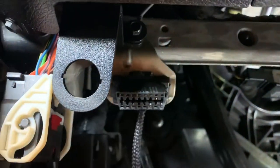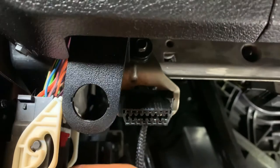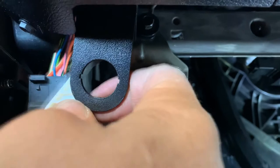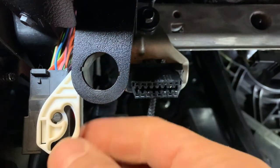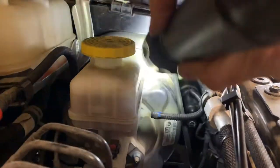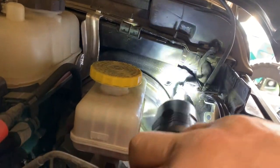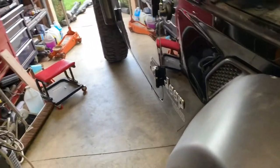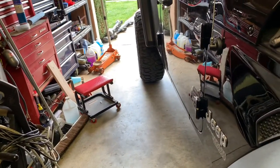Something else that may be a carryover from the JKs: when you put this bracket in up under the screw, if you take your doors off, you're going to hit. So I'm going to have to readjust this bracket. You can see in a lot of videos talking about passing things through a grommet on the firewall — but if you have a stick shift, that is a no-go. You're going to knock that grommet out and hit the piece of plastic holding the clutch pedal assembly.